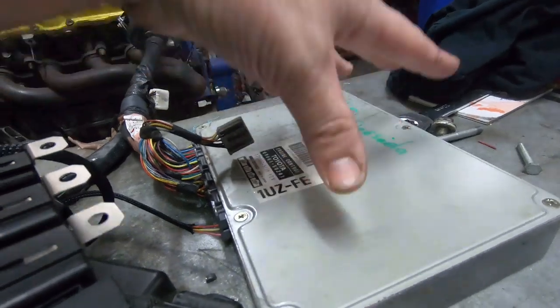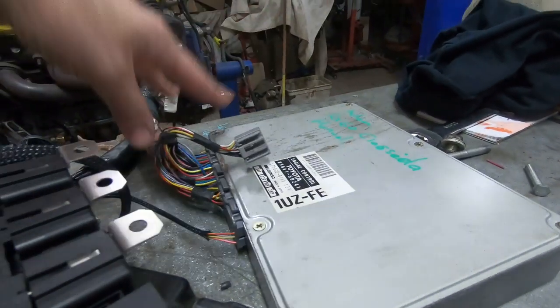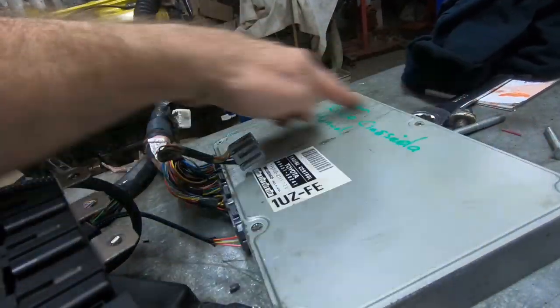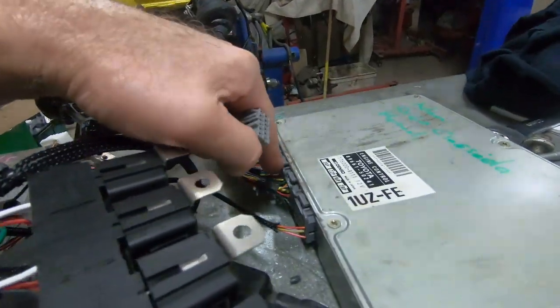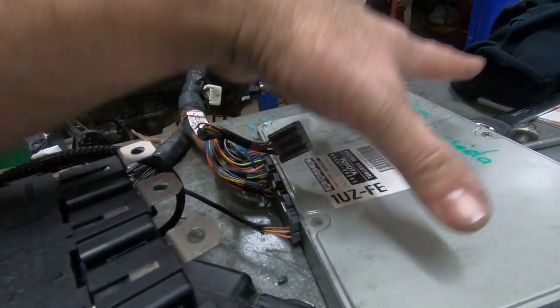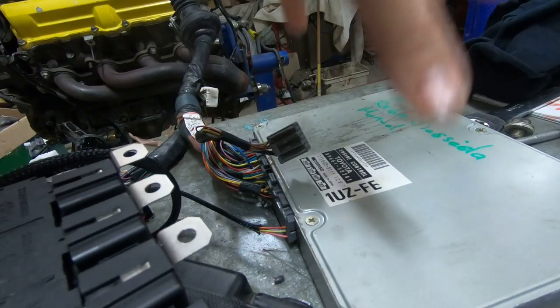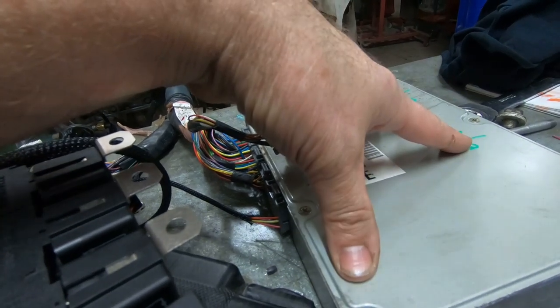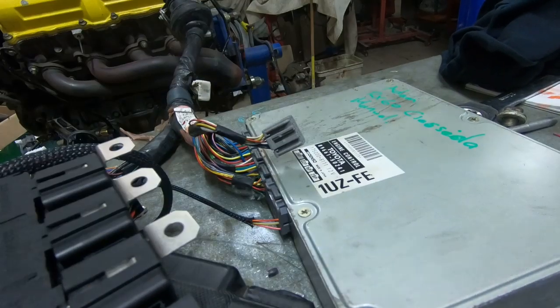So in this particular case, the customer sent me the ECU, that one. I've checked the numbers match with the wiring loom, and I actually found some corrosion. There was some bit of rust, bit of ugliness on that ECU. So I've checked it. I actually started that one this morning and it ran up fine, so we're good on that.